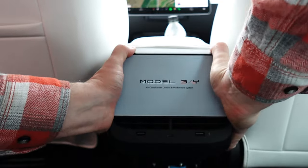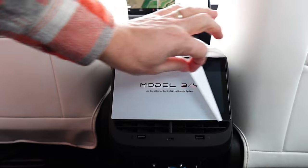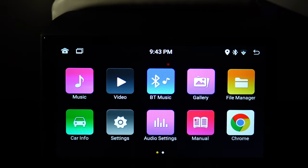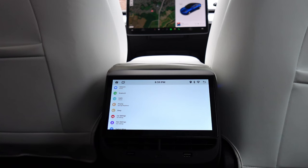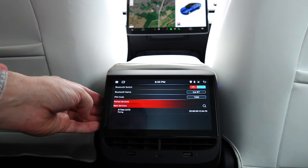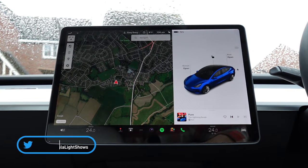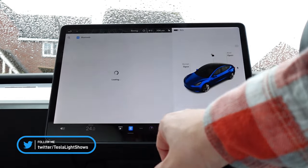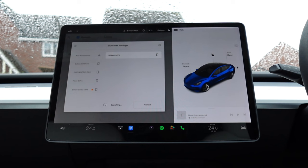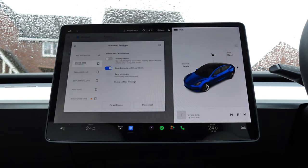Now this should just be a case of reseating the unit into place. Wow, that looks really cool — the kids are going to love this! From the home page, the first thing we need to do is connect the car unit up to Bluetooth. Select Bluetooth from the list, which brings us to the Bluetooth menu. To connect, we select the car's Bluetooth signature. Then moving to the front screen, we'll connect the unit by selecting the Bluetooth icon and tapping Connect Phone. We'll press Start Search to find the Bluetooth signal and pair. We have the unit Bluetooth pop up, so we'll select that and wait for the two sides to connect. The connection's been made, so now we're good to go.